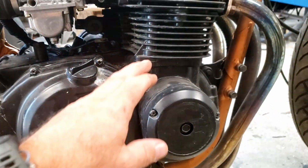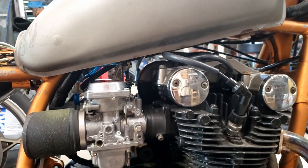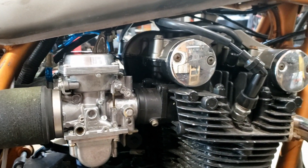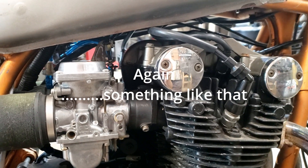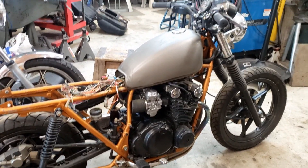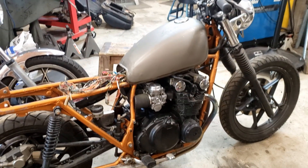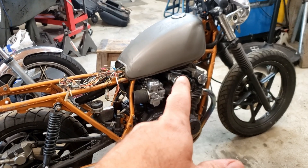So that's when I put this new electronic ignition module on, and everything was running — I had spark. The problem was after the bike heated up, the heat rises and gets into the coils right underneath. Once they get warm, they just stop producing — they get a lot more resistant. I searched and searched online and finally found a guy who had the exact same problem. He was like, 'what in the world, I've done this, I've done that.' So I felt like my carburation was good and my electronics were good up to that point.